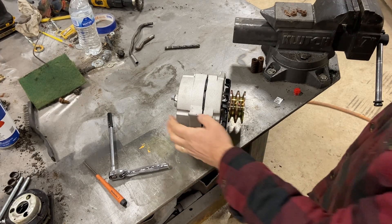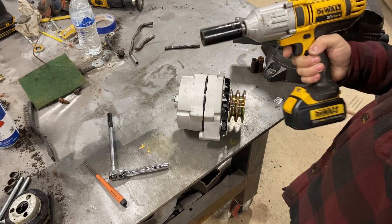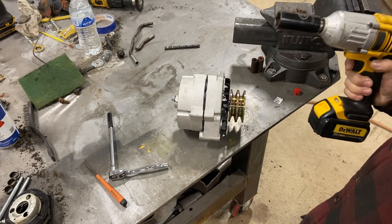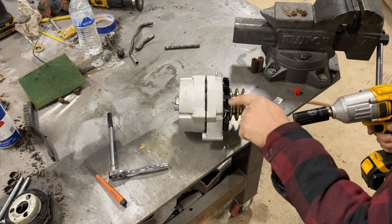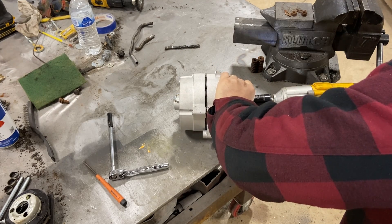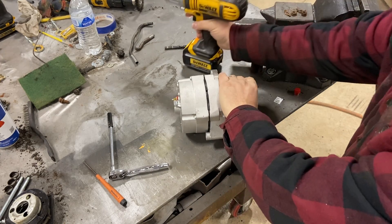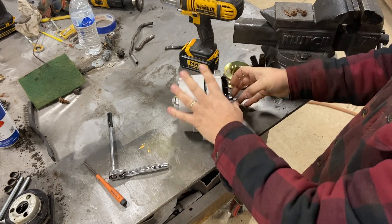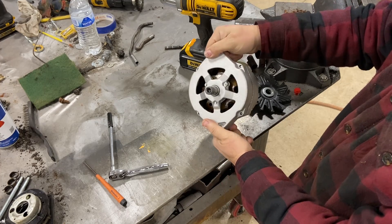Okay, we're going to continue on how to re-clock an alternator. Grab your DeWalt and make it loose. Grab the pulley with one hand really firm just so the fan doesn't eat you up when it spins. Grab it really firm, hit it with the make-it-loose. Spins off. Drop the nut. Washer comes out. Pulley comes off. The fan comes off. You have just the case.